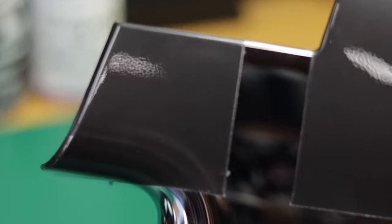So overall, my conclusions: number one, 2k clear is so much better — yes, it doubles the cost if you're using Shadow Chrome at $20 a can, but the clear coat quality is so much nicer you'd almost be foolish not to use it. Adhesion promoter was the biggest culprit in ruining the finish and increasing texture from my last video. I've realized Shadow Chrome is still great if you apply it without adhesion promoter and put 2k clear over it — that's why I went ahead and redid my badges with it, and they came out so much better: reflective like chrome and smooth because of the 2k clear.